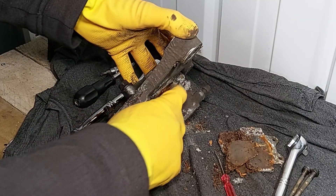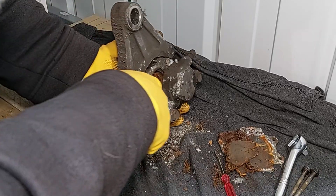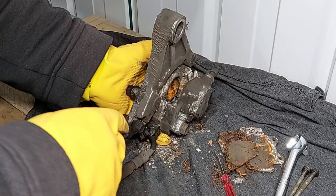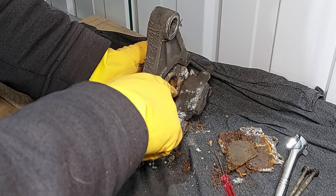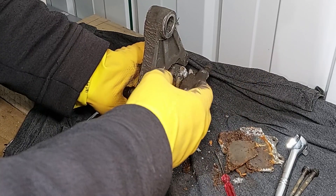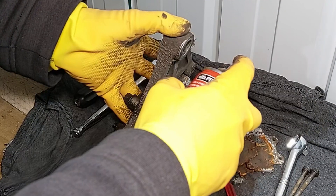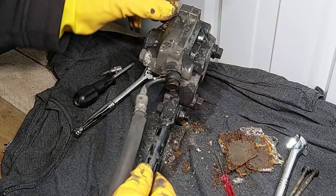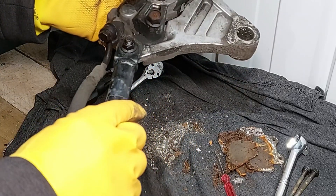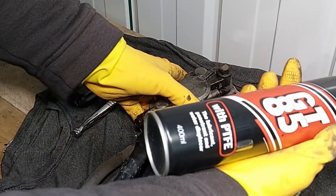They're probably going to be seized. I don't know if you can see the two pistons in there - one, two - they're all rusty inside. I'm going to have to buy a piston kit; there'll be two seals either side, about 40 quid - I'll put a picture up now so you can see what I'm on about. These bleed valves here are going to be tricky as well - there's one there and another one. A bit of GT85 on those.